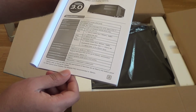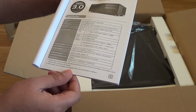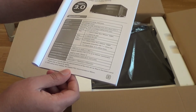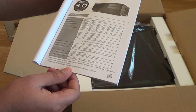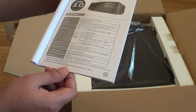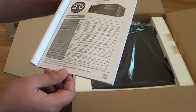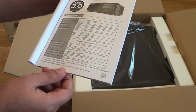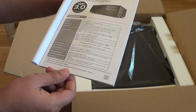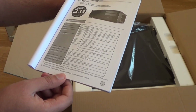On the top it's got oversized vents. On the bottom it's got three 120mm intake fan slots. I'm not sure if the fans are included or not, but it might be by the looks of this. They're meant to be 900 RPM with 18 decibels, which means they're nice and quiet. Backwards compatible with one 120mm fan and three 80mm fans or six 60mm fans. I don't think anyone's going to use one 120 with three 80s or six 60s, because it will probably end up being very loud and whiny. I think three 120s at 18 decibels will be plenty of intake. So that's along the bottom.